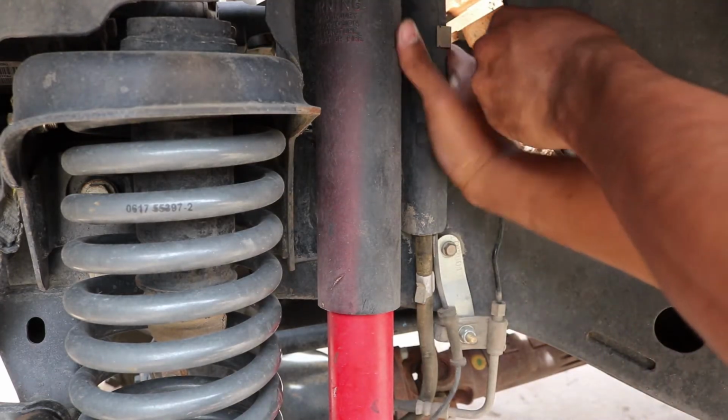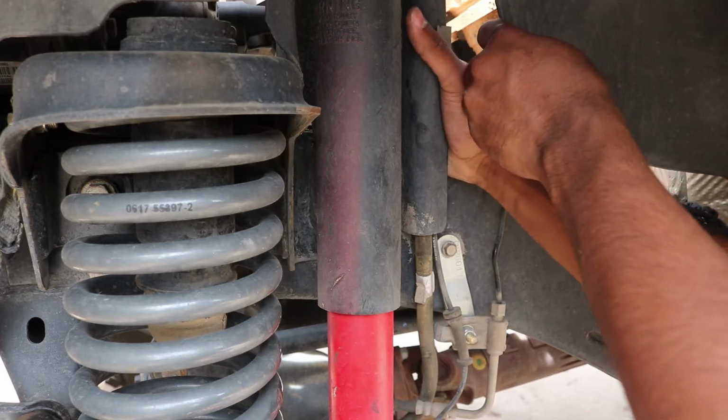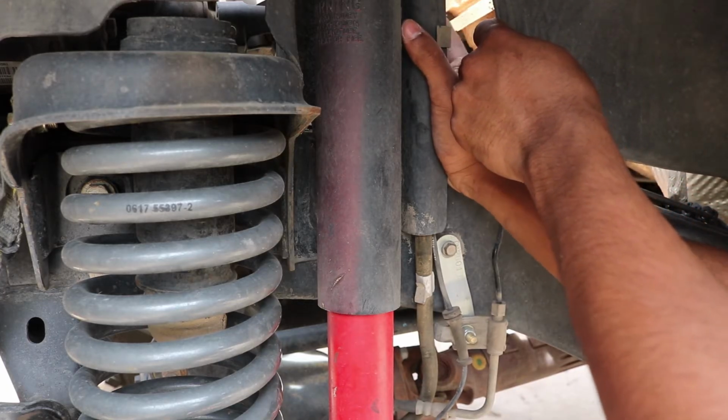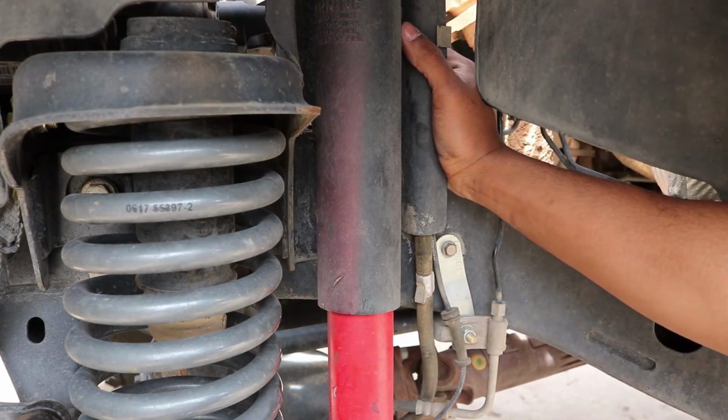You have to pull on this fender liner right here, and reach around and kind of know what you're doing. So if I were suggesting anything to you, it'd be climb inside the engine bay, see how it connects, and then maybe you can come out here or just do it from the engine bay. You can usually get to that harness plug if you pull up the fender liner and stick your hand in, but I think it's really easy if I just sit in the engine bay and disconnect it like that.